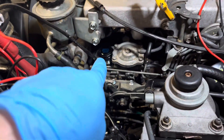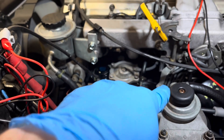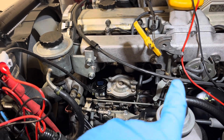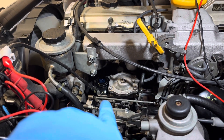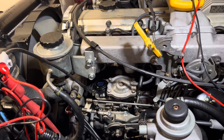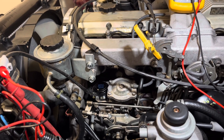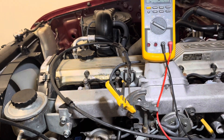I'll do a couple of test drives with that setting. The last part is that when doing this adjustment, the throttle needs to be fully open. I have a clamp here — I verified that's the position it will reach with the pedal — and that's the full max open position. That translates through the rod into the pump, and the throttle position sensor chases it. This is how you install a new throttle position sensor, or make an adjustment to a previous one back to service specs — for example, if you've had your pump rebuilt, removed, or nudged it by accident.